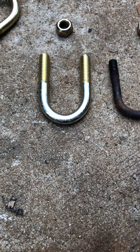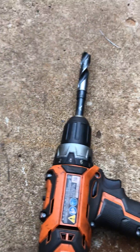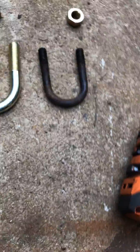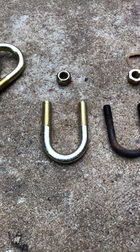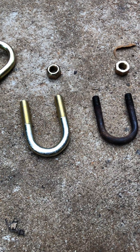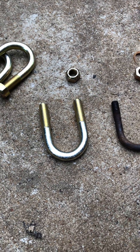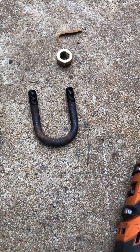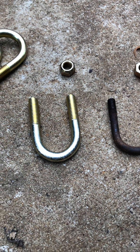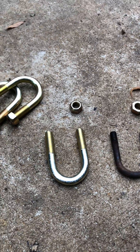It's a plus because a little bit thicker bolt means a little bit more meat — that's going to be stronger. What I'm doing is taking a 5/8 drill and just wallering out the holes a little bit, and those just slip in and you bolt them down like normal. These are going to be for like your 1973 and up C10 lower control arm U-bolts. If you're unaware, you can't actually find the original ones anymore as far as I know. With the later model ones, all you have to do is drill out the holes with a 5/8 drill and you'll be good to go. It's a really easy upgrade you can do for your suspension to add a touch of safety.